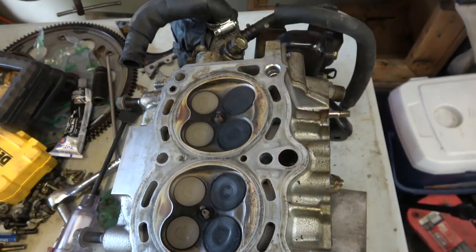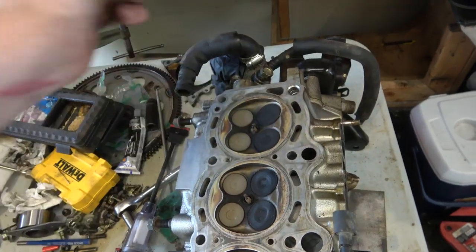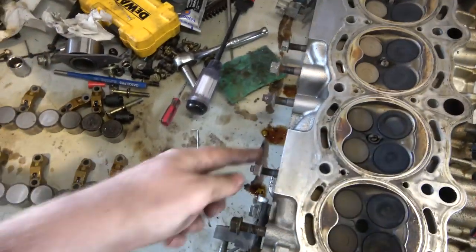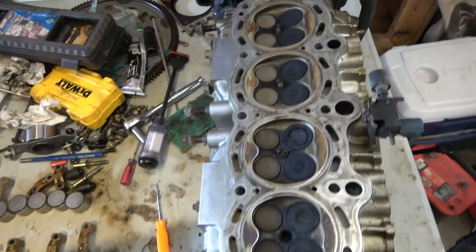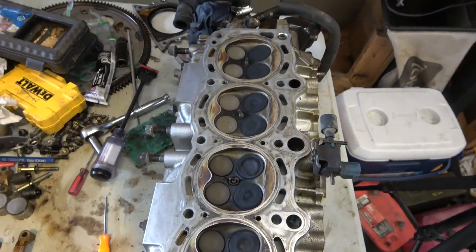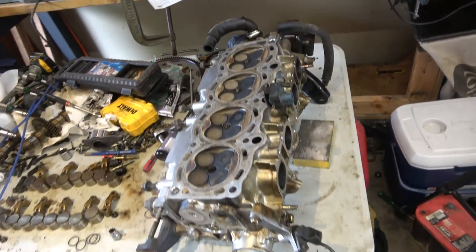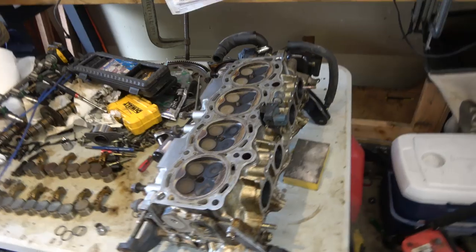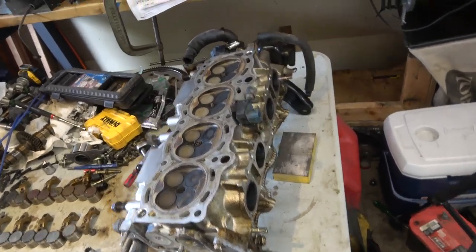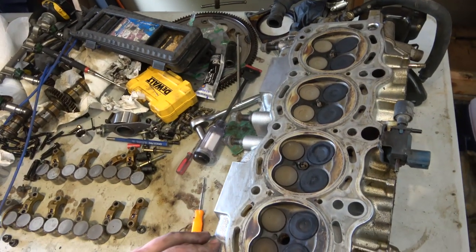Kind of like the orientation like that, because as the air and fuel comes in here, it ignites right away, and this is your exhaust. So I'm gonna finish cleaning this up and orient those plugs a specific way. It really doesn't matter all that much, but I want to do it anyways. It's a little hot rod trick hot rodders use. That way you maximize every little bit of combustion you could possibly get.